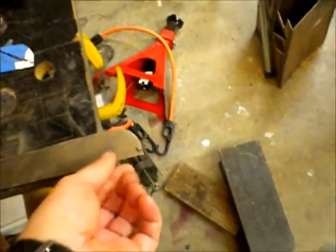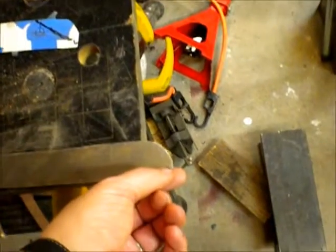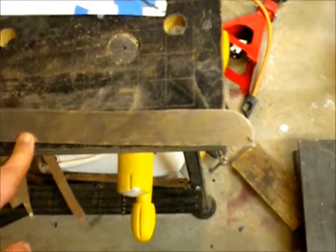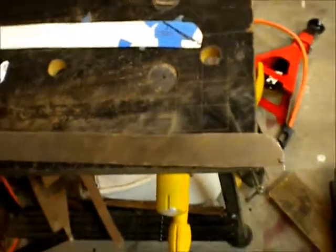Okay, so I got the flange cut out. I used my old template, just reversed. And it will go there, obviously. One thing I considered, I started to cut out this material. I traced the profile off the other panel, but I decided to leave this metal here. It'll make it easier to weld there with that extra mass, and I'll just cut it to shape later. So I'll tack this on and contemplate welding it tonight. Maybe I won't. We'll see.